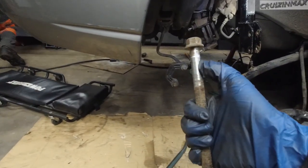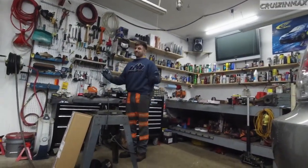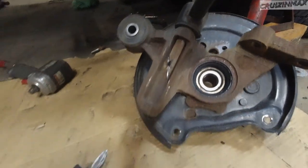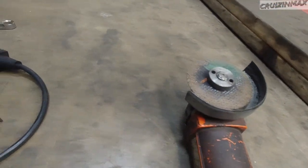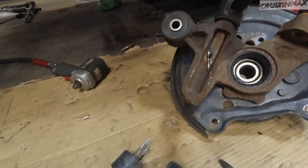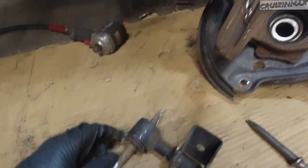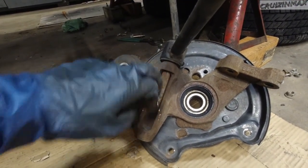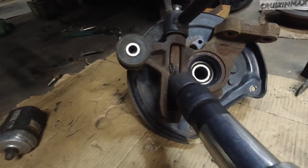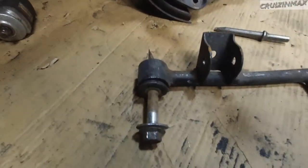The other side just came out — lucky! That side was rusted but the left side wasn't rusted at all. Should have started there. This one is halfway done — we took a grinder with a small wheel, cut in as far as we could without cutting the knuckle too much, then knocked it out from the inside. The bushing got damaged so that'll need replacing. There's still a piece stuck in the knuckle — cut a notch and used the air hammer but it's still not coming out.